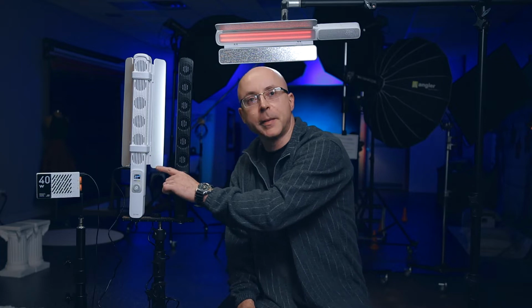And by the way, this is actually in the manual, and in the manual of most batteries, but for sure, it's in the manual of this light. So my Canon R3's battery is pretty warm. You think I'm gonna be actually charging this thing immediately? No, I'll wait until it reaches room temperature to be nice and cool, unless you wanna deplete the battery cells very quickly, so you buy another one from B&H about 3 months later. Wait until it cools down, so you can actually charge the lithium-ion battery.